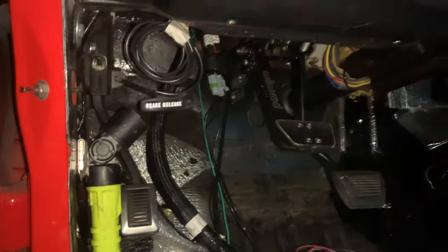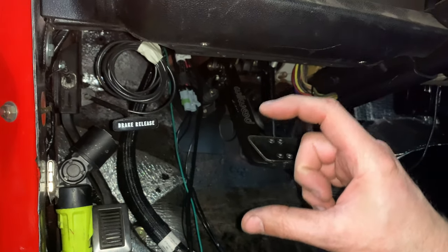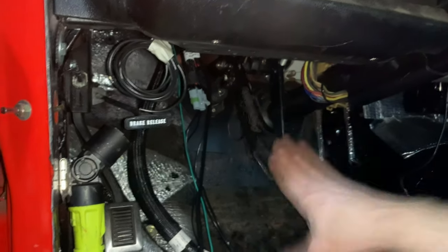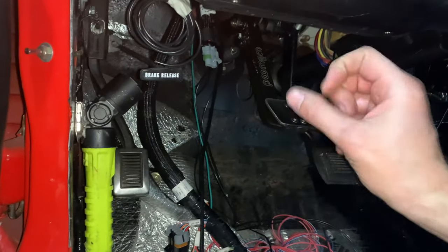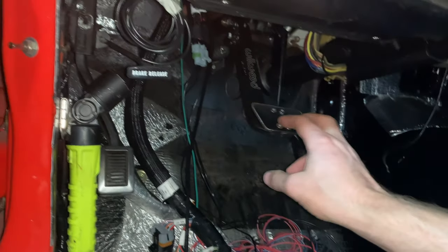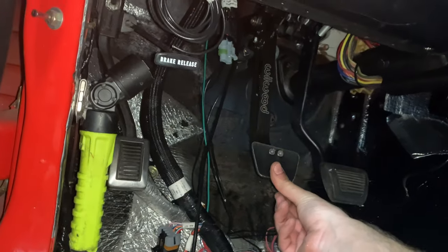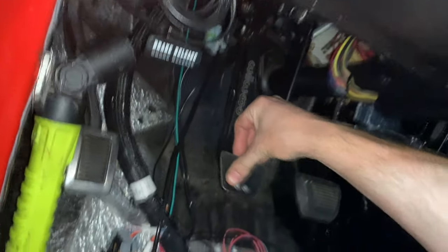I'm just going to change the master cylinder. It'll be the third master cylinder I bought. The first one was the one with the integrated reservoir, and then this guy, and now I'm going to get a different sized one. Getting that bigger bore size will bump up the quantity, so hopefully that should give it a shorter throw, so I can put this clutch pedal down where it should be, right about there, and then just that distance right there should do it.